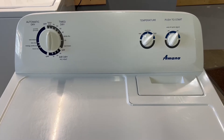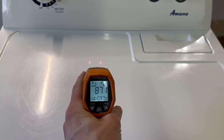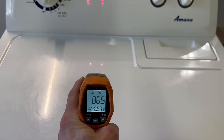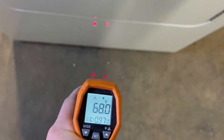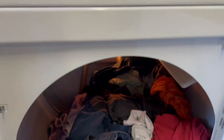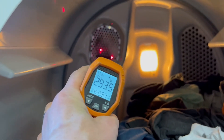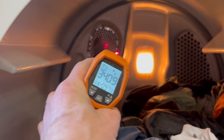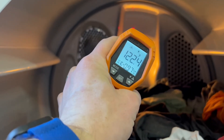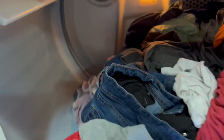We've got the surface temperature gun here — right between those two red dots it takes a surface temperature measurement. It's about 86 degrees on top of the dryer, and about 60 degrees on the concrete floor. Opening it up and shooting it right inside the heating element tube — there's plenty of heat coming out of that tube. That in turn heats the inside of the dryer anywhere from about 95 to 195 degrees, depending on the heat setting, and I've got this one cranking.